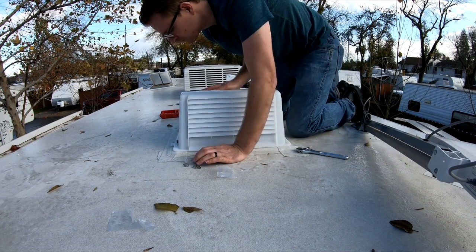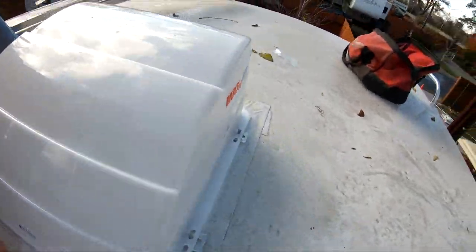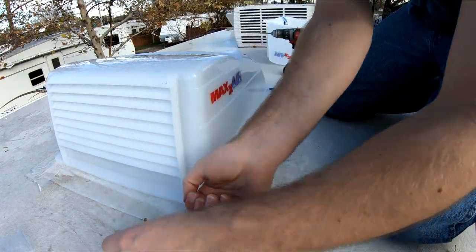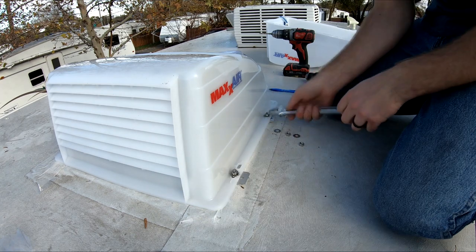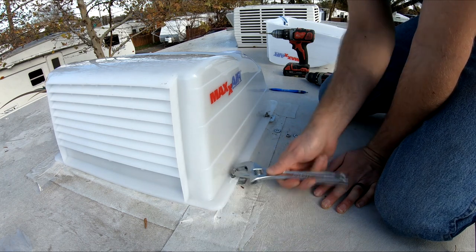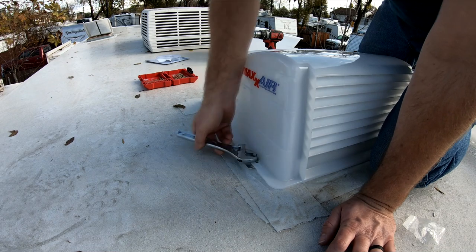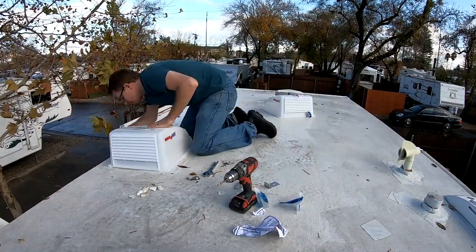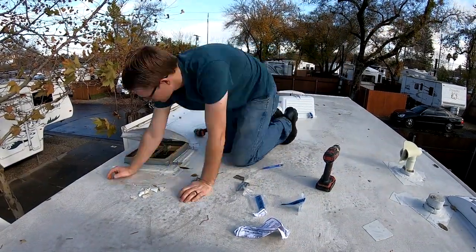You're going to want to put your nuts on those carriage bolts and go ahead and tighten them down. I figured out it's in a good position, so I'm going to put those nuts on and tighten everything down so that they hold firmly. You want the louvers on the Max Air unit facing the back of the RV — they're kind of tapered in that direction so that when you're driving down the road they're aerodynamic. All four corners have washers and nuts as well. Repeat this whole system on every other Max Air unit you're installing. On this one I have two more, for a total of three Max Air units.